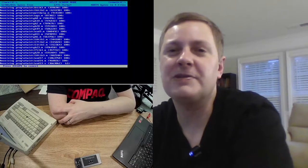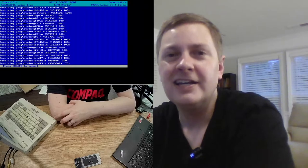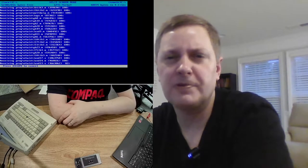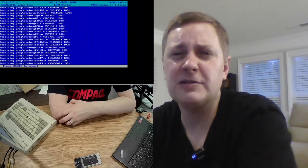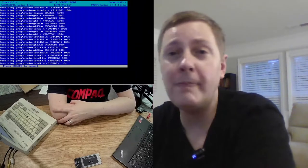So I had this machine for months and months running at 6 megahertz and didn't know it. Jumpered it up to 20, and I'm like, that's fast. When I got the machine, because it was basically a replacement motherboard for another machine that had failed, which was like 10 or 12 megahertz, I'm like, why is this machine so much slower? It should be faster. Well, that was why. After that, I'm like, cool beans.